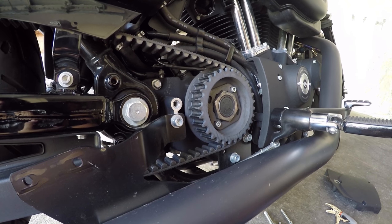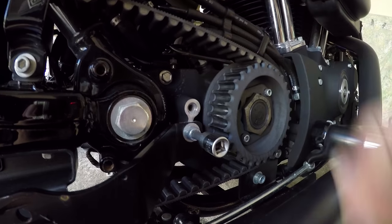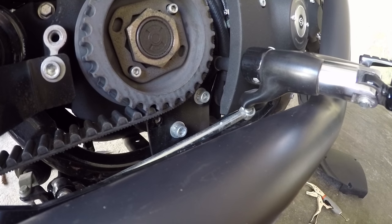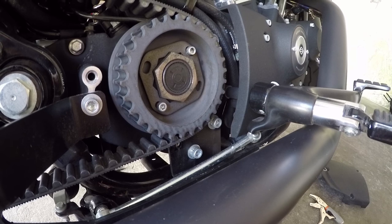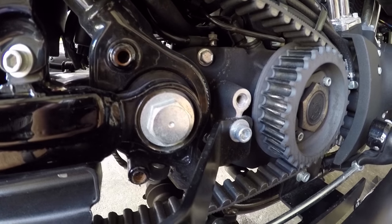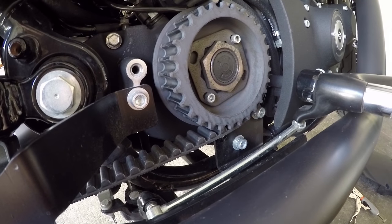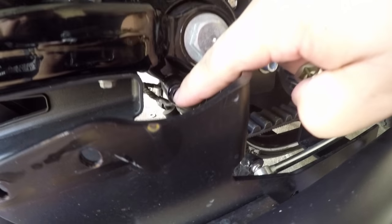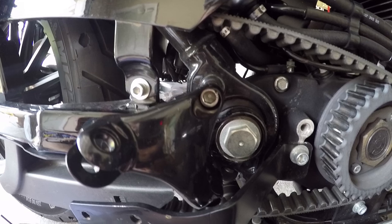Got the sprocket cover off after some fun angling. The bracket has three more screws — I thought there were only two but there are three. Suggestion: if you're installing an exhaust and you ever considering passenger pegs, just go ahead and install them then because it's gonna be so much easier. I'm actually considering just drilling through the bracket to get to that bottom threading for the foot peg.